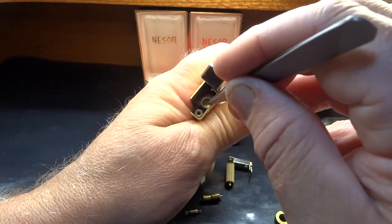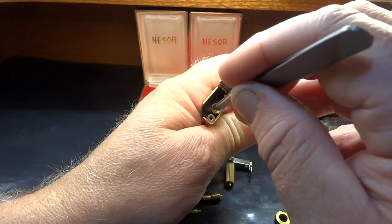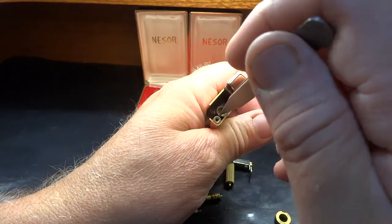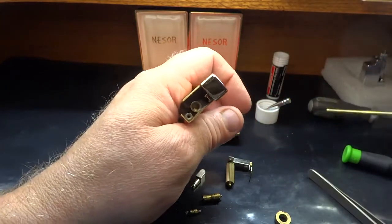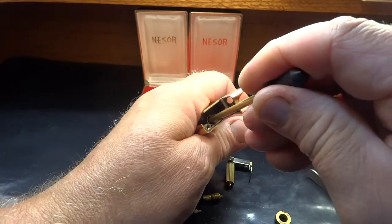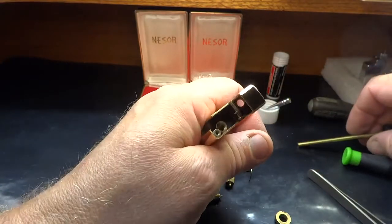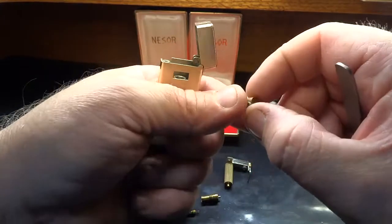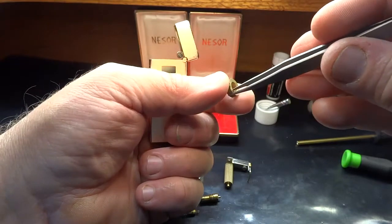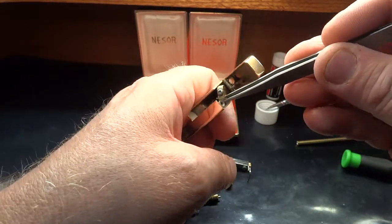Because sometimes there's a little bit of ridge sticking out from that pipe, just a little bit past these threads here. So, good. And I take this and make sure it's all the way in. Seems to be. Sometimes you don't know until you stick the valve in. Now, the flame adjustment wheel, you always want that little nub on it to face down.